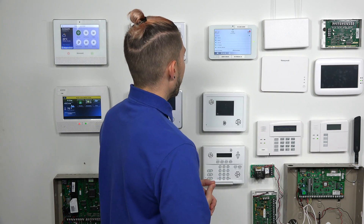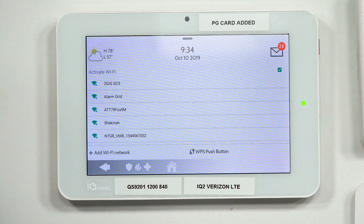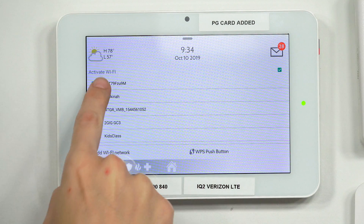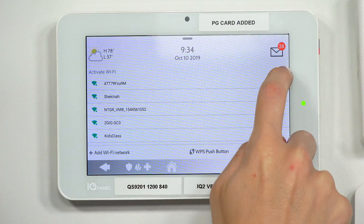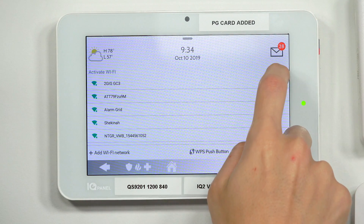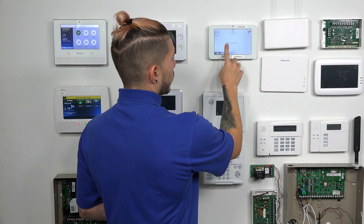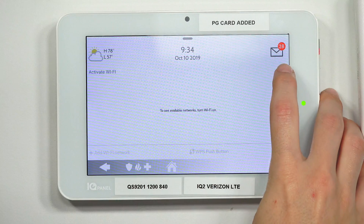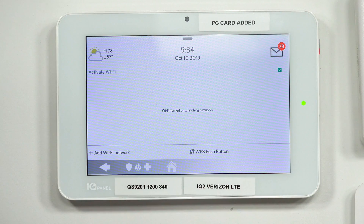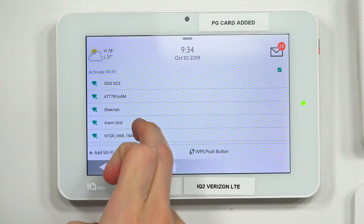As you can see, my Wi-Fi is enabled. If you are not seeing anything in the list, make sure that 'Activate Wi-Fi' at the very top has its checkbox checked on the far right. If you uncheck that box, you'll see no Wi-Fi networks available, and it'll say 'To see available networks, turn the Wi-Fi on.' Make sure there's a checkmark in that box. It'll say 'Turning Wi-Fi on' and 'Searching for networks,' and then a whole bunch of networks will appear for you to scroll through.